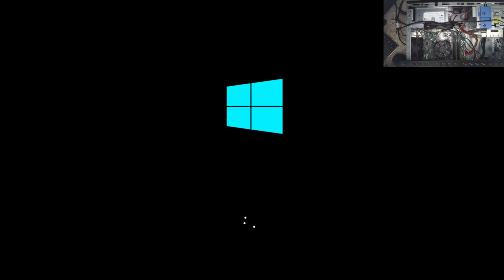If I have it my way, or the way that I trust more so. Not saying you can't do Windows over top of Windows and end up with good results. You can. If you get a brand new computer that hasn't been used, you boot it up and say it came with 7, and you want to upgrade this PC with the media creation tool, you could install Windows over that and probably end up just fine. However, when it's a well-used, well-worn-in installation of Windows 7 or Windows 8 or 8.1, and you're upgrading to 10, this truly is the best method. Do a clean install. It is not outside the scope of possibility for even your most average person.